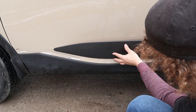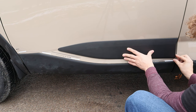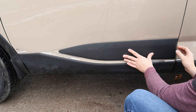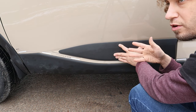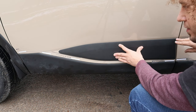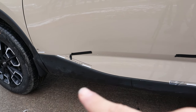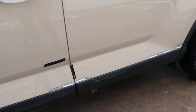All right, so it's basically lined up just like that, leaving just a little tiny gap in the back, about 1 millimeter from the edge of the door. So you can see just that tiny gap, and then resting on those lines. Before adding the adhesion promoter, they want you to tape this line so you have a perfect template of where this is supposed to go. I'm lazy and I don't have tape. Okay, I lied, I got tape. But anyways, A, B, C, D, one side, perfect.